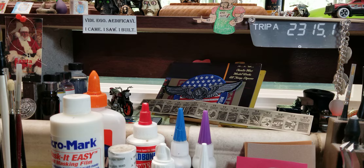Floating power — a revolutionary new engineering principle — makes the Chrysler Imperial smooth and quiet. A new automatic clutch eliminating the necessity for depressing the clutch makes driving supremely simple. Chrysler Imperial freewheeling is an entirely separate unit at the rear of the transmission. When you are freewheeling, the gears are at a standstill, disconnected from both the engine and the rear wheels. The Chrysler Imperial high compression engine develops 125 horsepower.